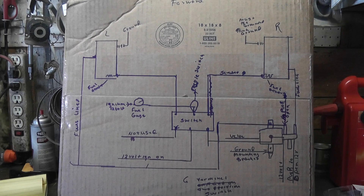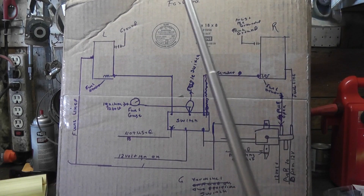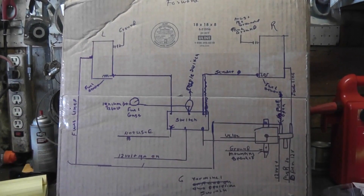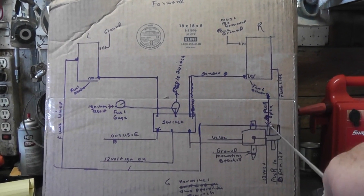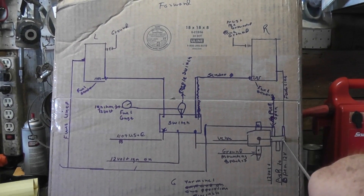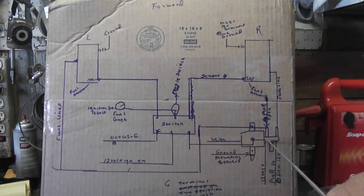When you run out of fuel in the left tank, you're going to switch over to the right tank. All you do is flip the switch — it closes this right here, closes that valve, shuts that off, opens up the plunger in here, opens up this valve, allows the fuel to come into here, and this goes out to your carburetor.